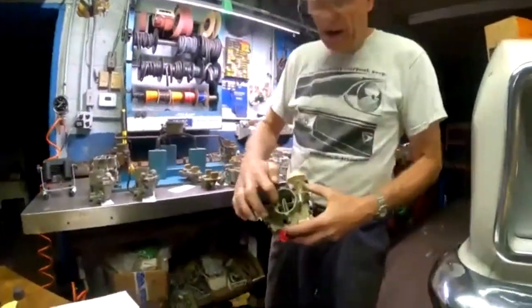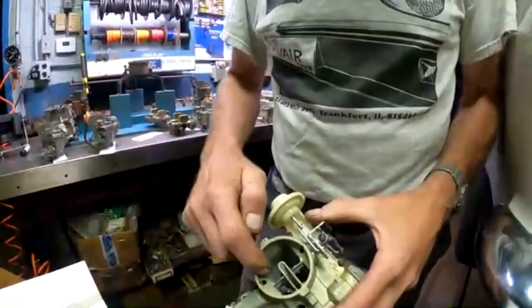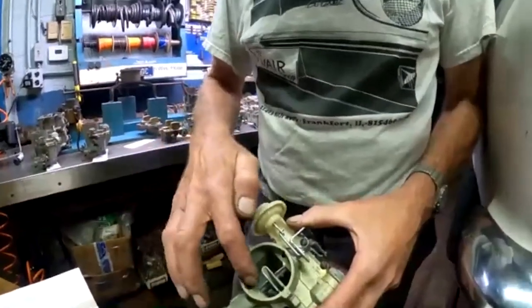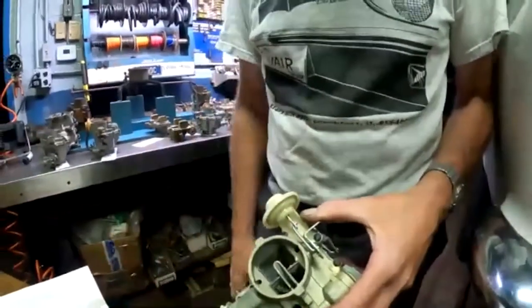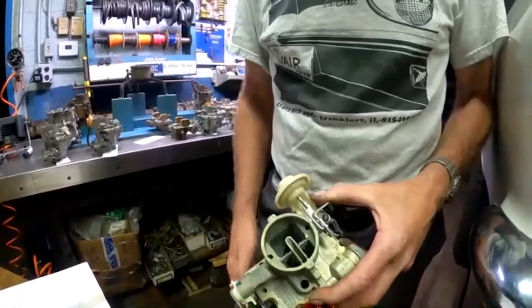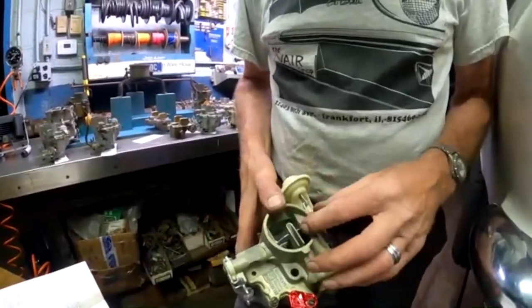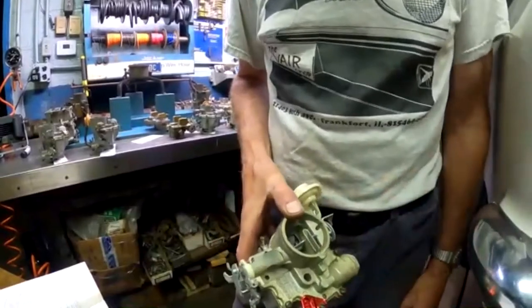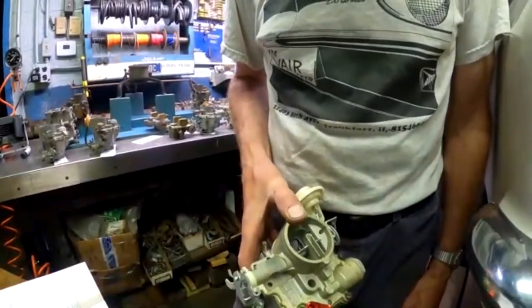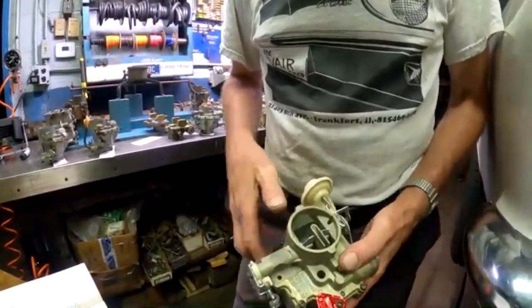It's going to come out of these vents, and of course, that's your air inlet. So the raw gas is coming from the vents and going down into the carburetor, and we call that turn cutoff under severe cornering. So you autocrossers know about that, and it's kind of self-correcting. Keep your foot on the floor, and eventually you'll use up that gas. Of course, your runtime will be poor. There's ways to fix it.